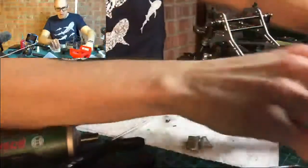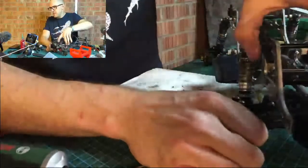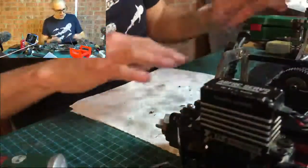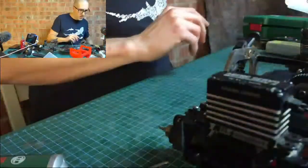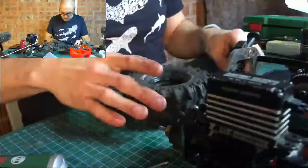So, where are we? Right, we've got pen spring mod on the front. So that now has that lovely pen spring mod that stops it from extending too much. But we've still got plenty of flex, we've still got plenty of twist. Rear shocks. Oh, yeah, they don't settle as quickly as they did, which can only be a good thing. Right, we'll pop some wheels back on and then take a look at where we're at.